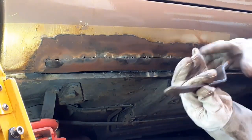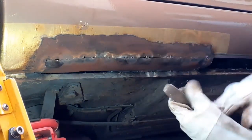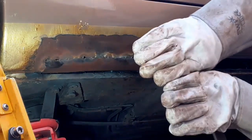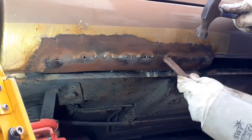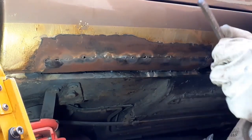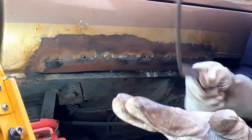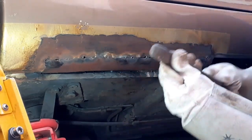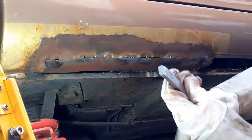I've got an old file here which I've sort of shaped — it's got a nice lip on it on the other side. Because of the heat distortion, the panels are not lying flush, they've overlapped slightly. So I'm just going to catch the edge there with my little sort of spoon of a file. I've bent this file and I use it for slapping — it's a slapping file for slapping bodywork long panels when you're trying to create a very gentle curve.